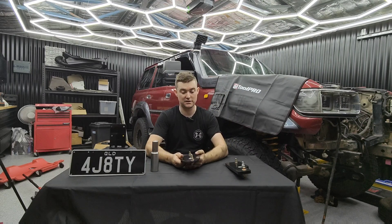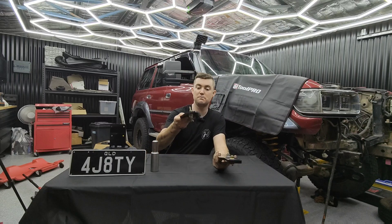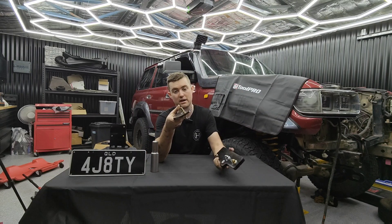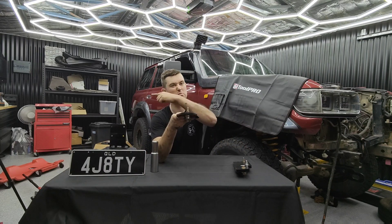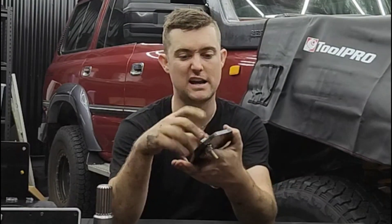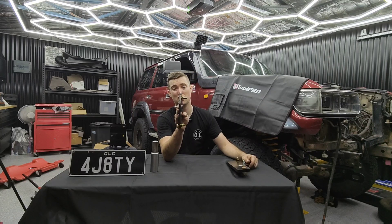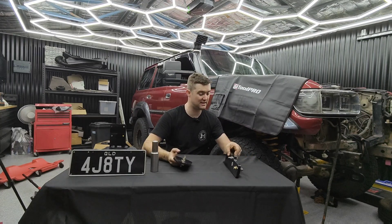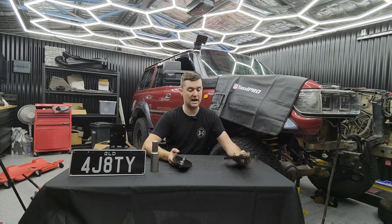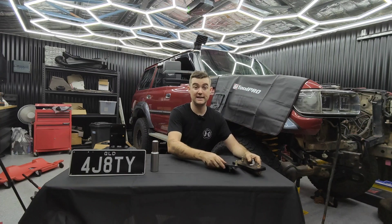On each side of the chassis here on the 80 series there's obviously a mount where it came off of. This bolts the standard 4J engine mount onto the top, which then just bolts to the top of the engine on the side. And then this here bolts to the 80 series chassis - there's one on both sides. He's designed this out of about six or eight mil plate steel, so you're never going to bend this in the history of your life. You bolt them up both sides and the 4J sits on top - easy as that.